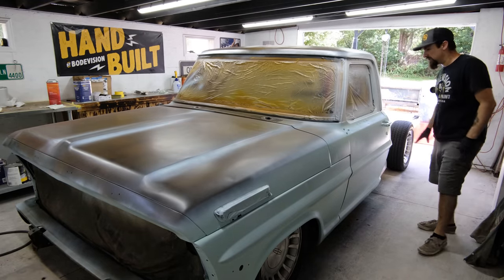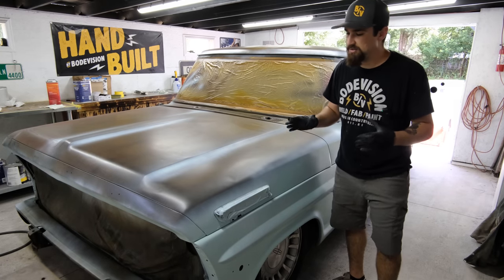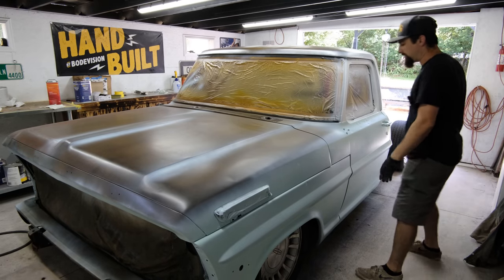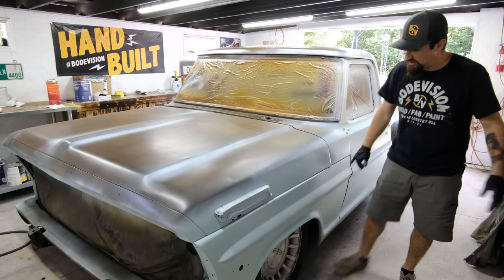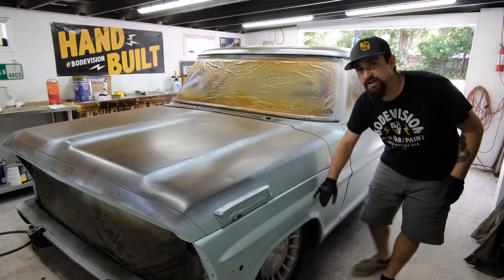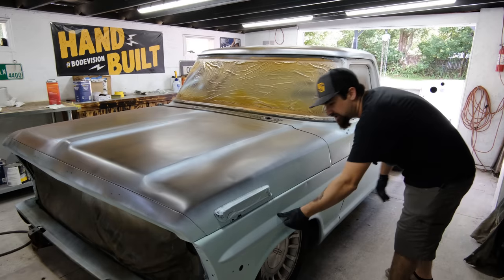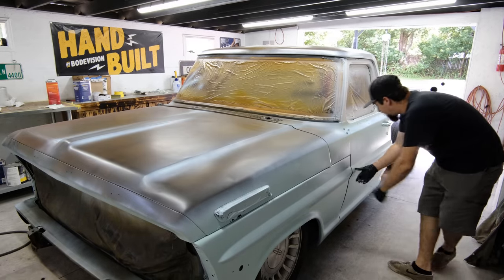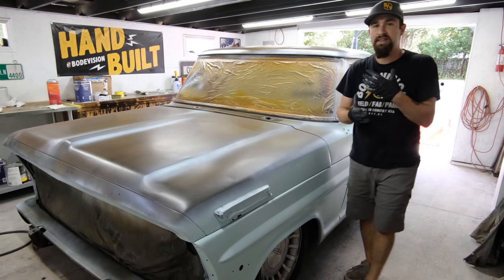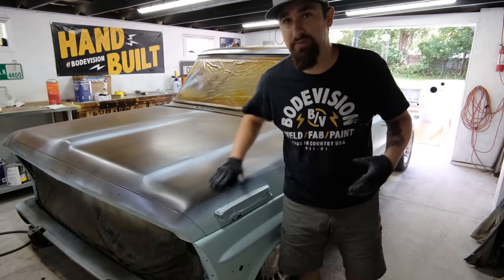So what I wanna do is take my 600 grit sandpaper. I'm just gonna throw a time lapse on so you can see exactly what I'm hitting, how I'm doing it, how long I am doing it, and what I am going for. In some of these areas, when I was painting with the browns and the blacks and those undertones, I purposely gave myself a lot more speckled texture, because those speckles are going to be the first thing that comes through, and that gives it a nice look that this truck had been getting rubbed on and weathered.